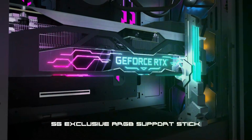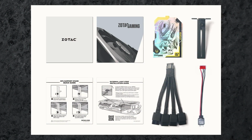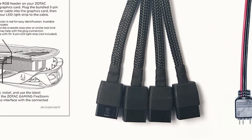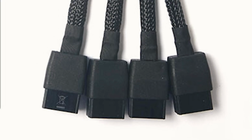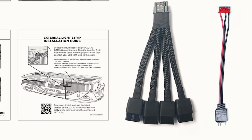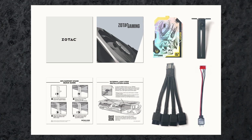The reason for the 4 connectors is because they wanted sufficient juice going through to the graphics card, so that if some of the connectors weren't properly seated inside the adapter, you would still get the 600 watts that you needed through at least 2 cables. You need at least 2 cables to those 4 adapters for it to carry the full 600 watts. Some people might not properly seat the 8-pin connectors into the adapters. They would have redundancy by having 4 connectors, so you'd have 2 chances to get it right. And that is how we ended up with 4 adapters.